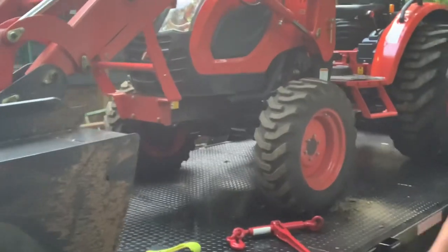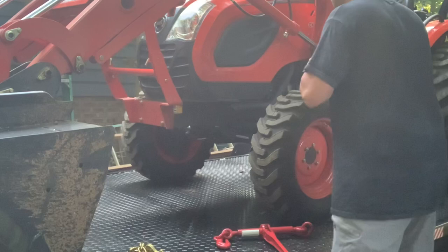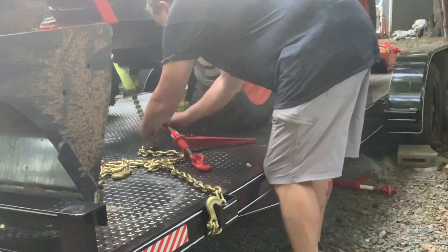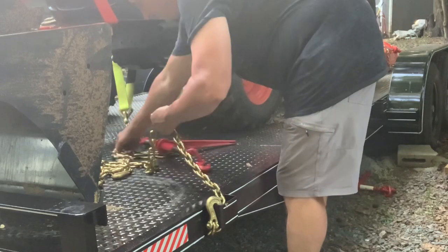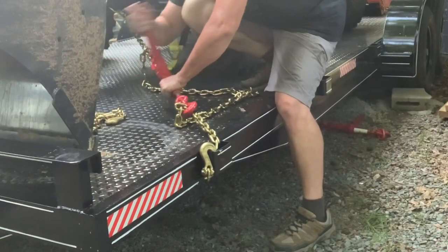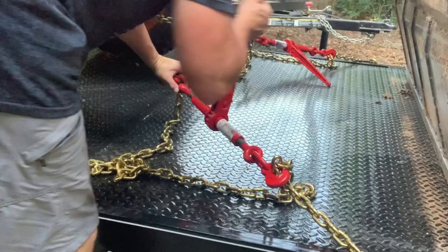On the front end there really aren't any good spots to tie the chain around, so I bought nylon tie-down straps and used those to wrap around the axles. I crossed those over and hooked the chain onto the straps so the chain doesn't scratch up the axles. This was my first time using ratchet binders and I had a heck of a time — I had to get them extended far enough so they'd tighten before the chain got too close to the binder and wanted to twist around it. It took a while, but I finally got it figured out.